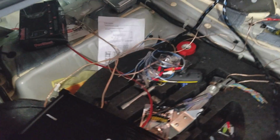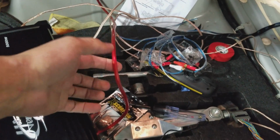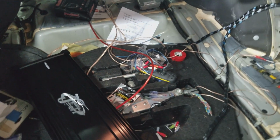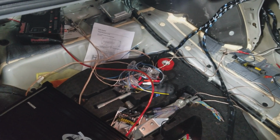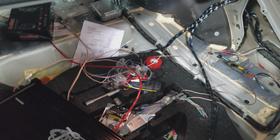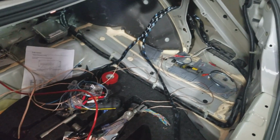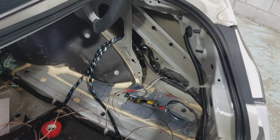This is a 5000 watt amplifier, and the wire that they ran to the back is 8 gauge wire. Now the problem is that it's not thick enough, and the heat might overload it. The chances are it will burn the wire. At the same time, you can burn other stuff in the car. So to have an amplifier done correctly, it's always good to use a professional.